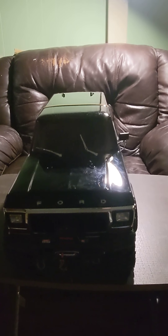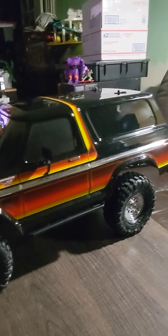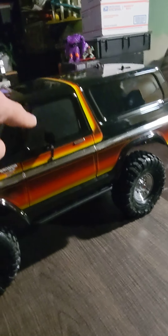If you were wondering why my front windshield looks much darker, I used some polycarbonate spray tint on the inside after I lightly sanded it with a thousand grit, and it really makes it look nice. That's the black panel paint, and here's the tint. You can really see in there if you really try, but you can't really see the wiring like you used to, which I thought was an eyesore.